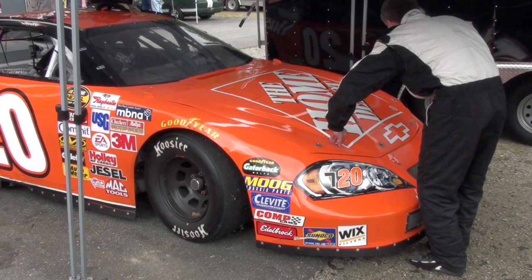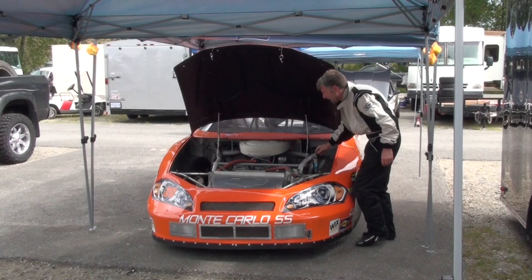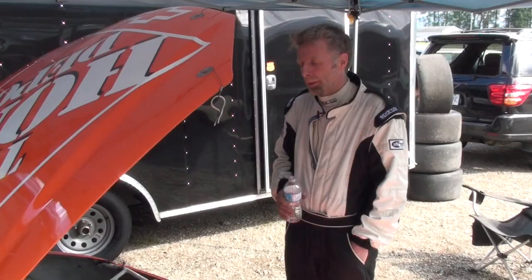Okay, so the drivetrain of this NASCAR basically consists of a 358 small block Chevy. It runs on pump gas, 9.5 to 1 compression. It's got a set of 18 degree cylinder heads, makes some extra power there. Dry sump setup makes, I was told, about 600 horsepower. It's never been dynoed, so we'll find out maybe at the teardown at the end of the season.